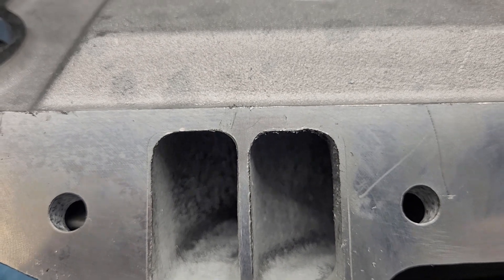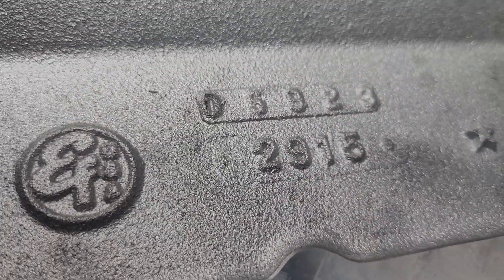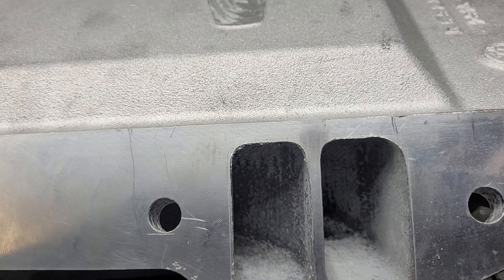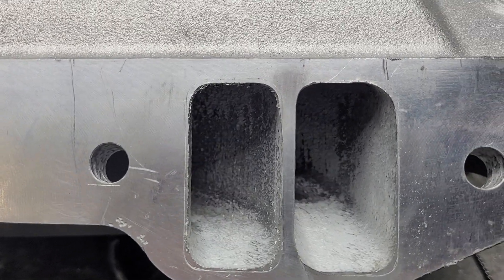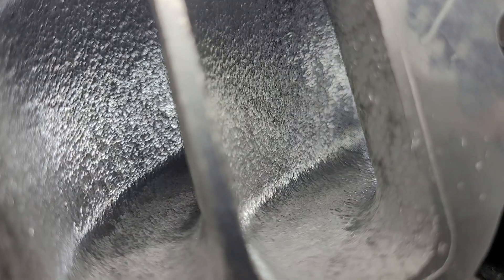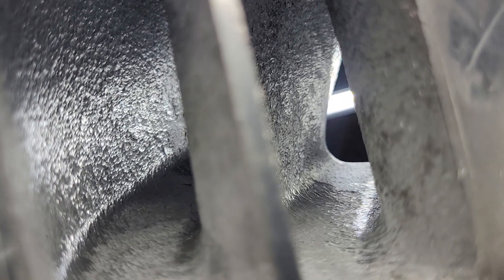The core shift on this manifold was not fantastic - very rarely they are. Part number 2915 - not a cheap piece, this was bought brand new. I think he picked it up from Summit. This is getting hooked up to the EQ China heads. They're roughed out so you will see some spots that I missed - if you take a look at the very end of that runner on the right, I didn't get it.